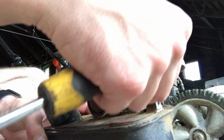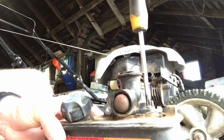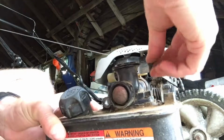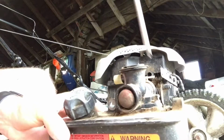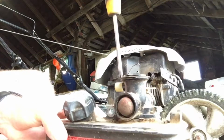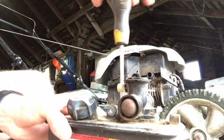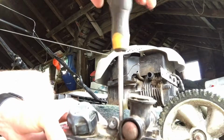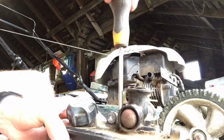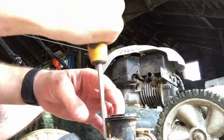And always remember, you never want to tighten the screws down all the way until you've got all of them in, all of them started. It makes for a difficult time if they don't line up quite right. There's no play there to readjust. Now that they're all in, we'll go ahead and snug them all down.